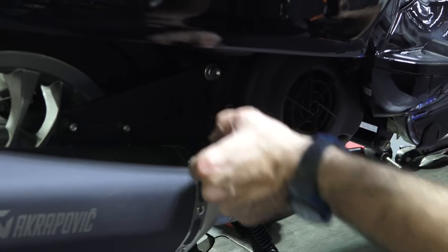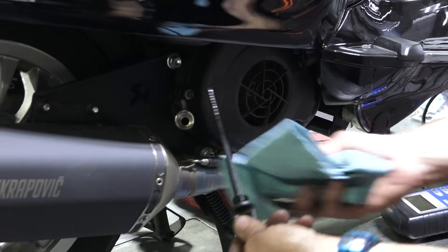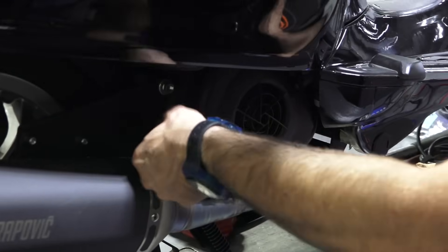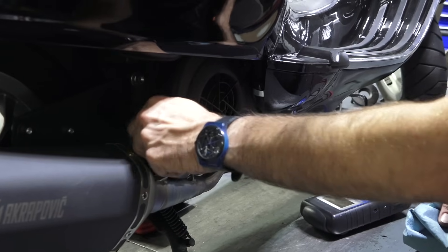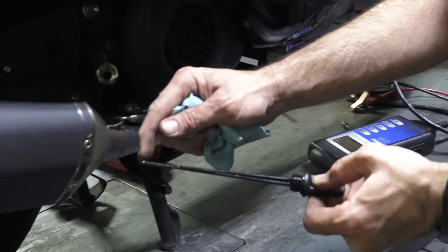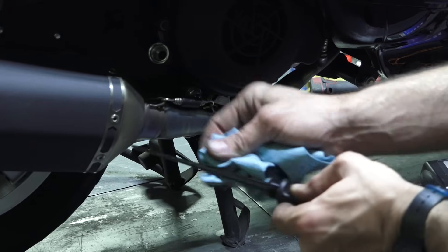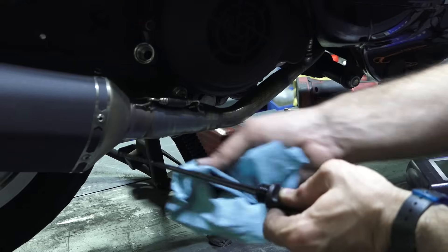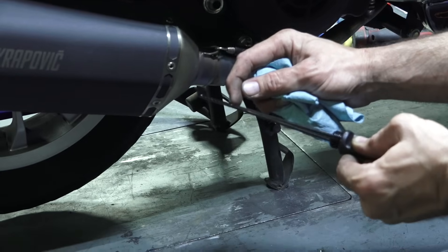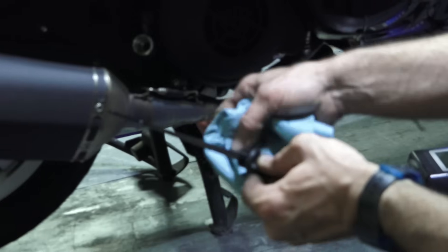Have the scooter on the center stand on a level surface — that's very important when checking the oil. Pretty much unscrew the dipstick and go ahead and wipe that off. On all the Vespa products, stick that back in. You can get a more accurate reading with a cool motor; you can check it as well with a hot motor, but they usually run a little bit high when they're hot. The oil goes all the way up the dipstick and stops right at that mark — that's the high mark. Down here is your low mark. The safe running level is right at the high mark or above the low mark. Sometimes people overfill them and that's too much oil — they're going to have problems with the engine.